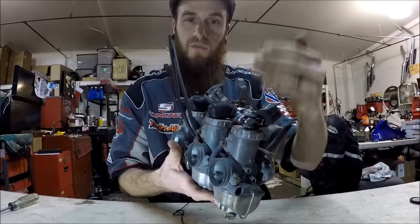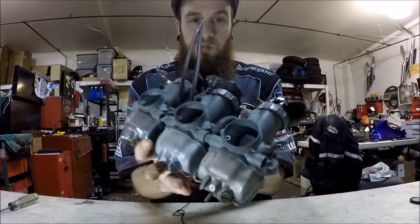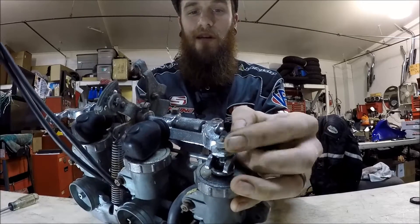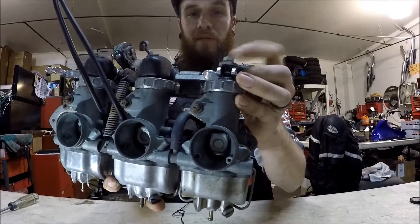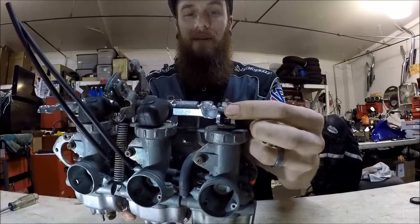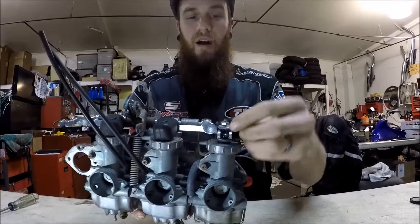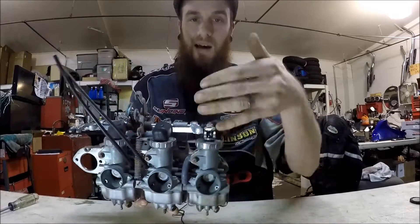Your adjustment that you make here is for individual carburetion. For this one, same kind of principle — go ahead and loosen the lock nut up, which would be that top nut here. This makes no adjustment to your slide piston. Instead, this big 17mm nut does. Grab a wrench — 10mm, 17mm — and crack them loose. A socket works good as well. Your turns on this bigger nut is what determines the height of that slide.